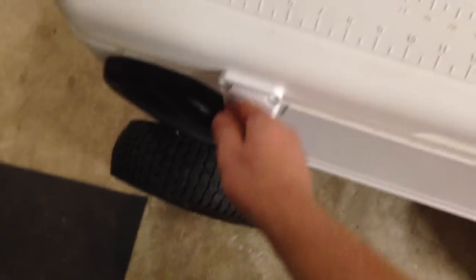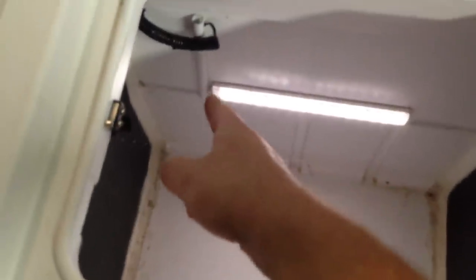One other feature I wanted to talk about was the beer light that I made. This has a quick hatch to get your beer, so I made a little fridge light. It's a waterproof LED light that I glued onto the side right there — real durable, doesn't ever come off. Beers and drinks hit it, water and ice cover it, and it never breaks. It's wired into this switch so when you shut the door the light turns off, and when you open the door again the light turns on. Most people didn't think this was going to be necessary, but once you're out on the beach at night and you want to grab a drink, it's pretty nice to have a light right there.